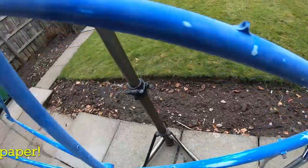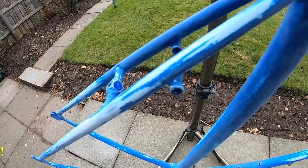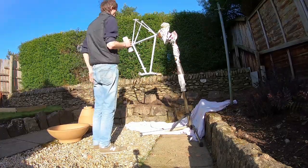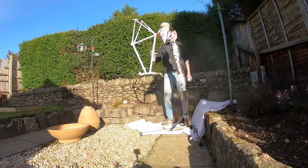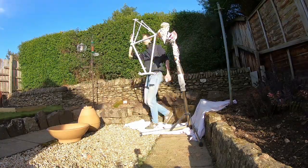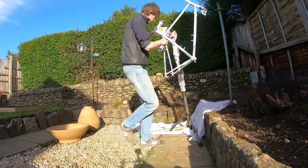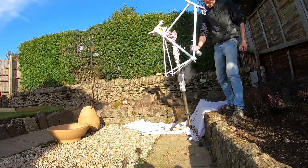It is worth saying that with 180 grit sandpaper you really do risk going through too much of the paint. To combat that I decided to reprime the whole frame with some Rust-Oleum primer, which claims to increase the durability of any paint job. Before going near the frame with any paint or primer you need to make sure it's spotlessly clean and that you've plugged up all of the holes - bottom bracket shell, bottle cage mounts, mech hanger, all that - otherwise if you get paint in those threads you might well struggle to get components back onto the frame. I also had to wait for the weather to improve, as both the primer and paint require 10 degrees or more. Living in Scotland that was a bit of a problem, but we did have a few sunny days so I managed to get on with the job.